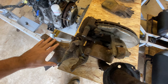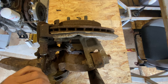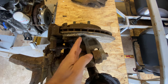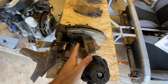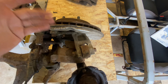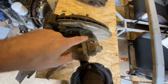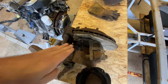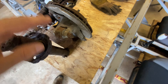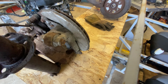Here is where the problem lies. This knuckle is attached to this trailing arm at three points. This point here - straight away you can see that's a problem because it's diagonal, it's not coming straight out. If I was to do like a Miata suspension, they'd just come straight out, pretty simple. But I don't like doing things the easy way because I'm a fool. So you've got this diagonal point, there's a point down there which actually slopes that way, and we do have one straight join here - so that's not so bad.